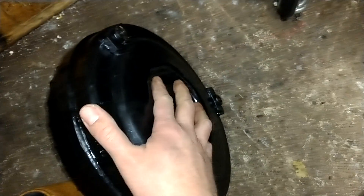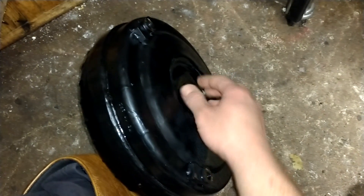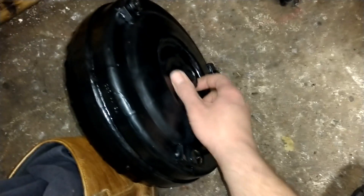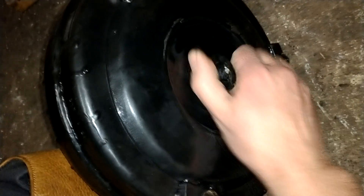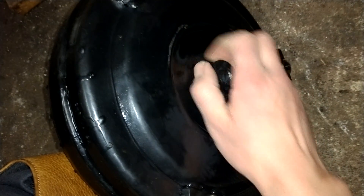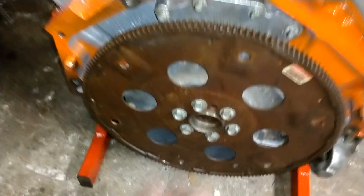My good friend Tony told me: anytime you buy a new torque converter, and this is a recommendation for every hot rodder out there buying a new converter — they tend to over-paint the hub. Make sure you take some sandpaper or Scotch-Brite to the hub, clean it up real good, and it wouldn't be a bad idea to do it on your crank flange itself. Clean all that out — the hub should spin in there freely.